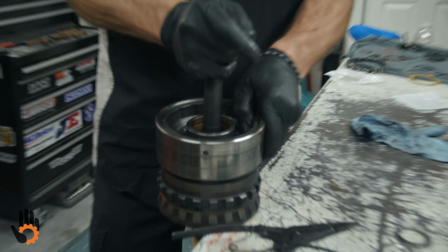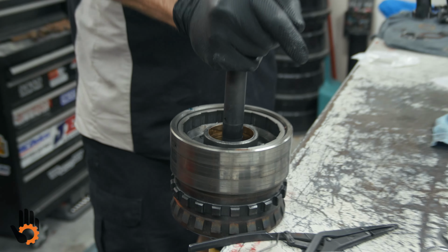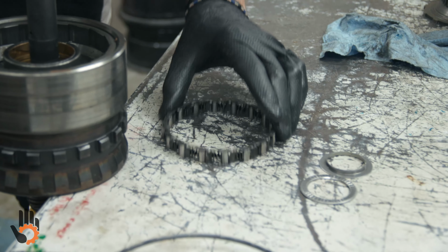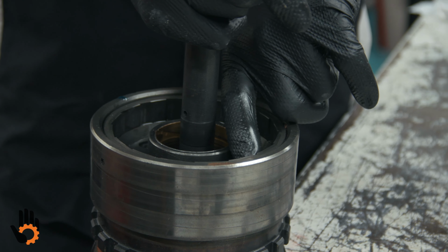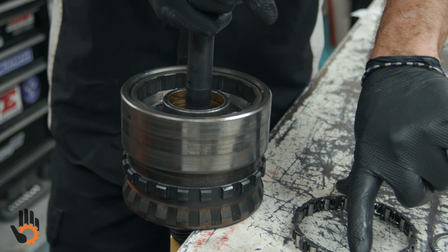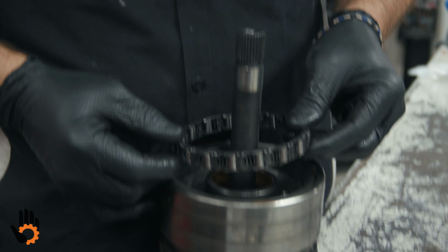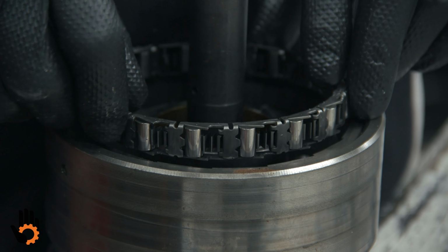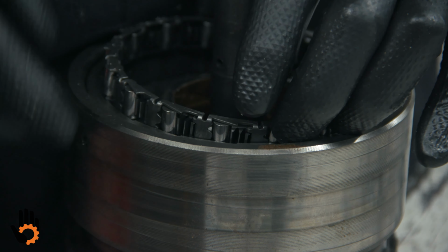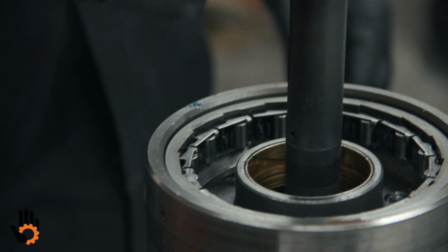And we've got to rotate that to get it to mesh to all the pinions, okay? And we need another one-way clutch, which is this guy right here, all right? Also spring and roller type, okay? That's going to have to come in here and mesh, if you will, or lock in here in this rear planetary. Notice the little ramps and the little edge on there. Pretty straightforward on that. Just double check you make sure you get that in the correct direction. If you see those are opposite, all right, we'll flip it over. And that should drop in there without too much of a fight. All right, you may have to push in on a few of the rollers, work it lightly down in place.